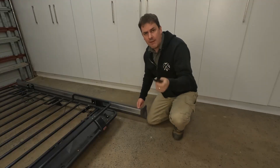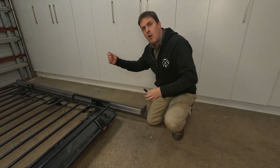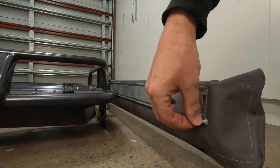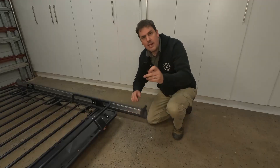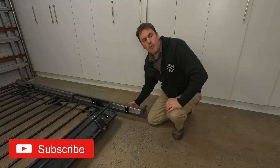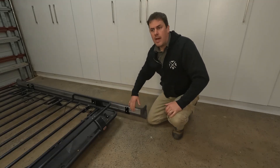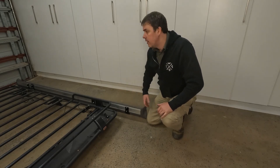From Custom Extras — it's definitely going to do the job. It lines up under the awning, one at the front and one at the back. You just chuck the bolts in the rails, put the bracket on, and that allows you to adjust the bracket up and down. The light is hidden under the awning so it won't get smashed off while driving, and it throws light whether your awning is out or in.